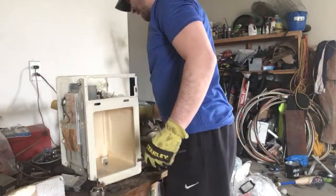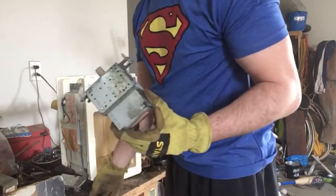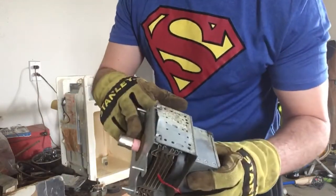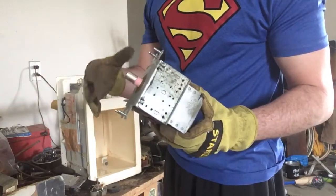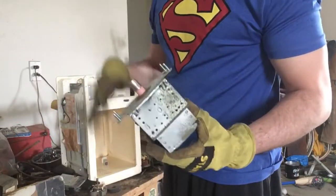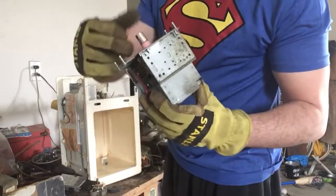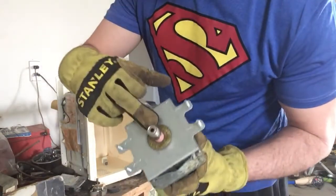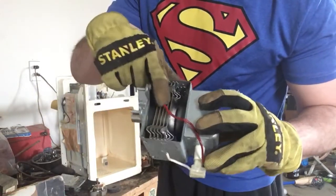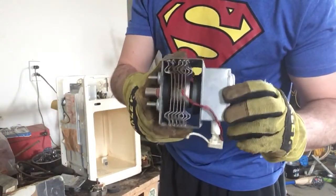The other thing this has is a magnetron. And the magnetron, I know there's gonna be a lot of YouTubers that say, oh, these are dangerous. They are. These little rings, these pink rings, sometimes they're white, some of them do have beryllium, okay? And the beryllium is very dangerous to inhale. I'm comfortable with it because when I go inside of this, I will put some tape around it to protect it. There is a nice brass ring that I will take off. Inside of here, there are a couple coils of aluminum. There are also 2 really strong magnets, hence why they call it a magnetron.